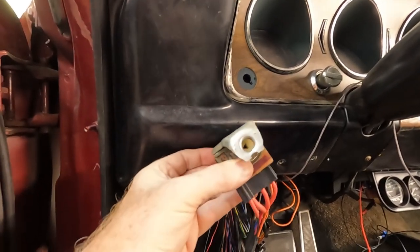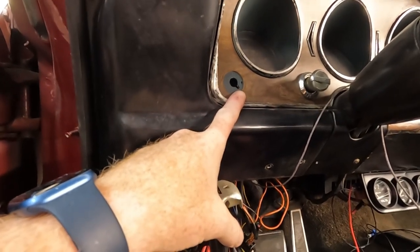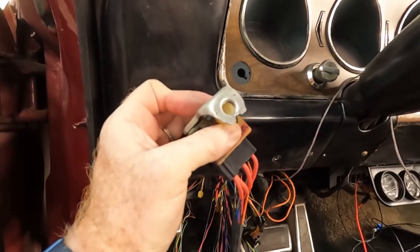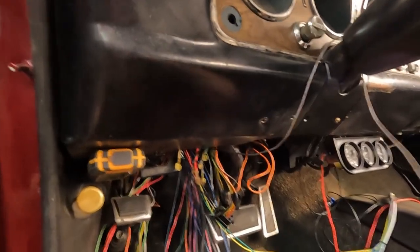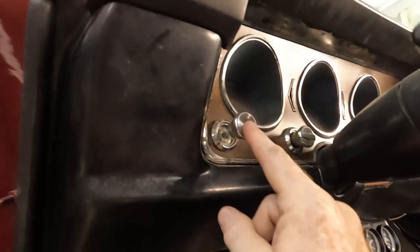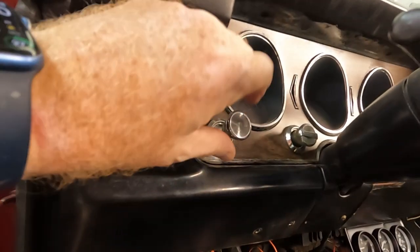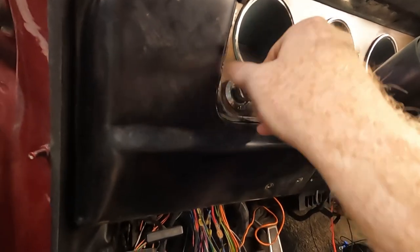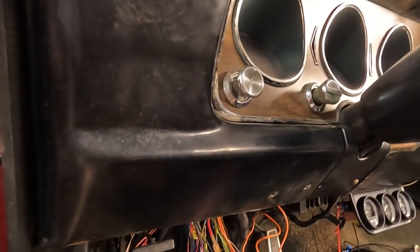One thing I noticed before putting the headlight switch back in: there's a little tab right here and a little notch. When I put it back up in there, I want to make sure I get that notch lined up so it goes in like this — that keeps it from spinning when you're turning and putting on the piece that holds it in place on the bezel. It was a struggle to get this switch back up in there. When you push this in, do not expect it to just click back on. You have to push that button again on the headlight switch to get it to connect, otherwise it just keeps coming out. Now it goes in and out, stays in there — click off, click on, so the brightness control can work. Hopefully I got all the wires in the right spot, but the headlight switch is done.